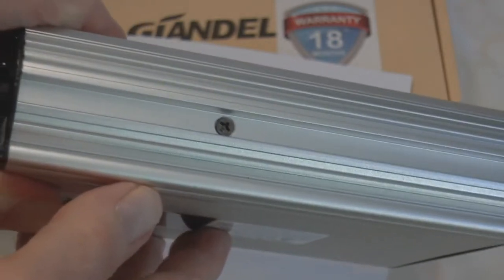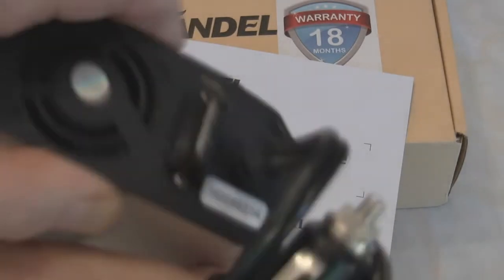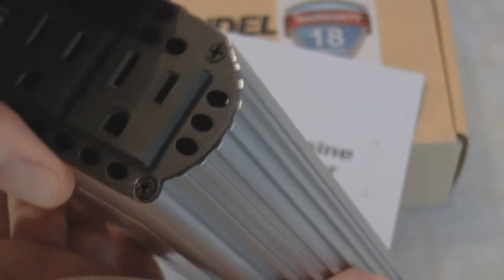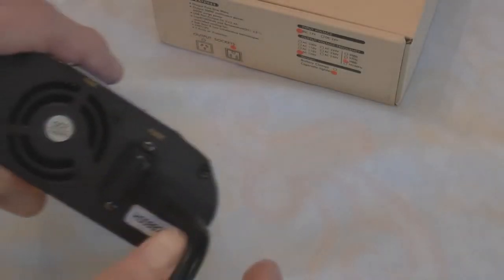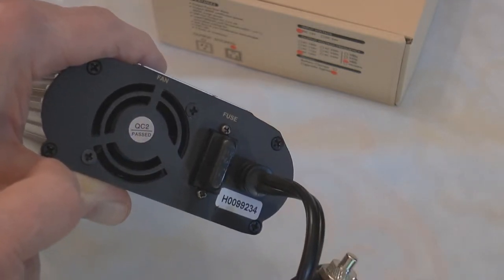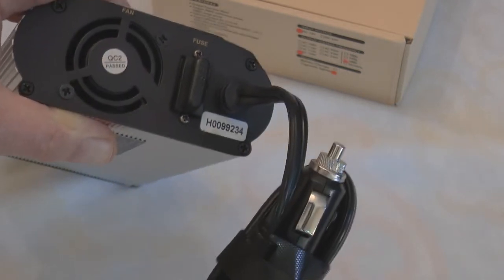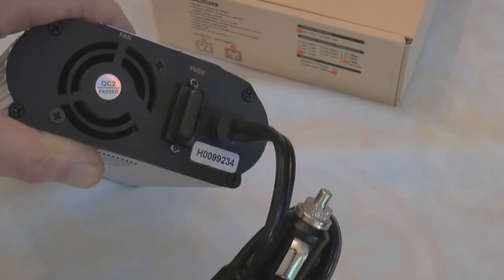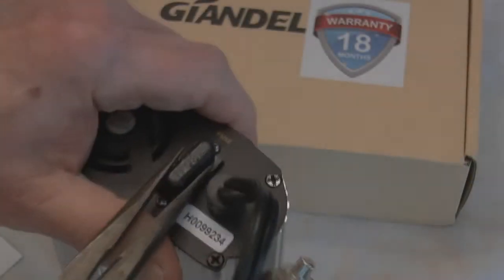When I took that screw out, I heard a nut fall inside. And when I did that, those plates were in there just as securely — the end plates were just as secure as before I pulled the screw out. So that instruction is incorrect. And by the way, on the other side of this fuse there are screws — do not loosen those screws, because under the fuse is a fuse holder, and those two screws hold the fuse holder on the inside of the plate. Do not remove those screws or you may have to send it back.